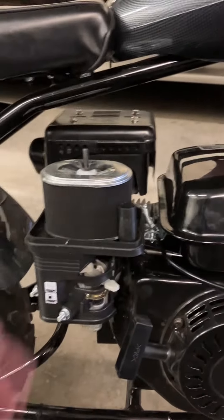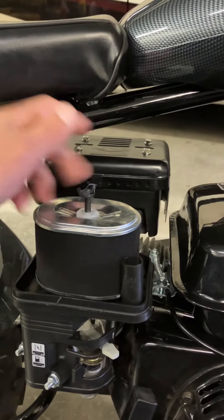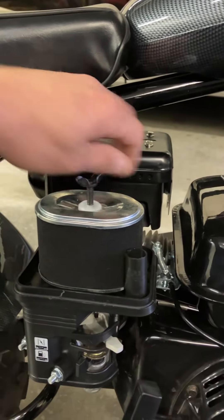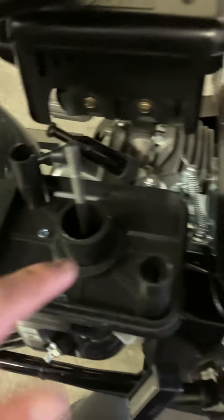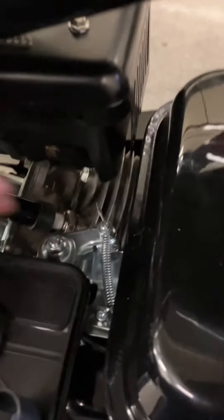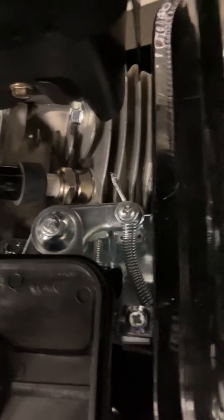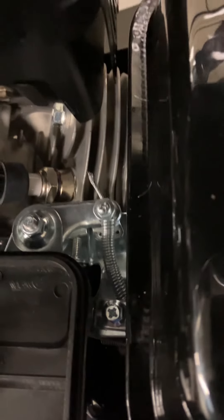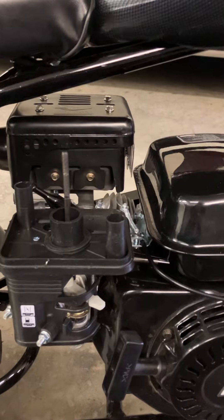First off, I have the box off this, but just to get a little better look. There's a box on top — you just take the nut off the top, then take that little wing nut off. You're going to want to take these two screws off right here. The first thing I did — if you look right here — you can see where I bent off the little flap that this screw rides on. Usually that flap would hit right about there. I took that out and I think I gained from 20 miles per hour to maybe 22, 23.